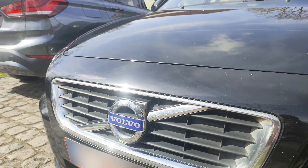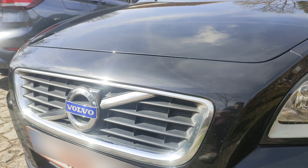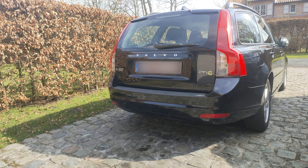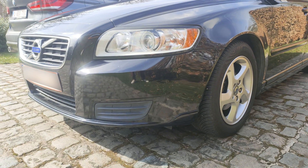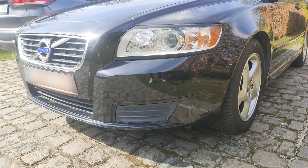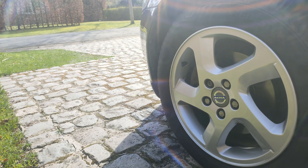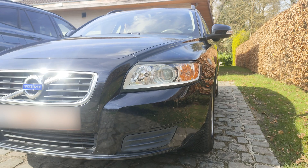Well, it didn't work out entirely. After going to Volvo and having the emissions tested, it failed again. I later learned that only a cracked or defective particulate filter can cause high soot emissions. The leaky injector was maybe a cause of a premature death of the filter, but with more than 10 years and 120,000 kilometers, the DPF probably already gave the best of itself. Stay tuned if you want to know what other secrets this Volvo hides and if it will ever pass technical inspection.